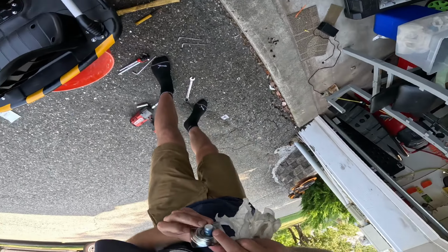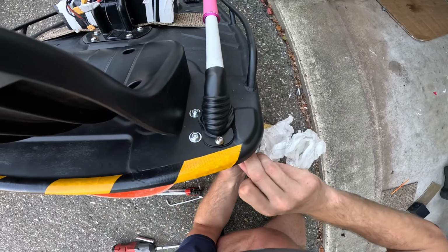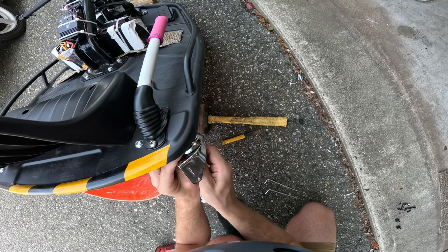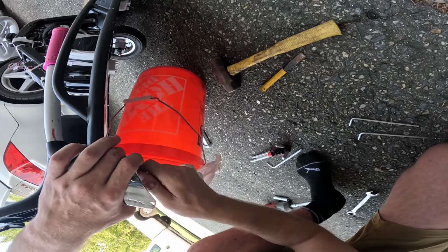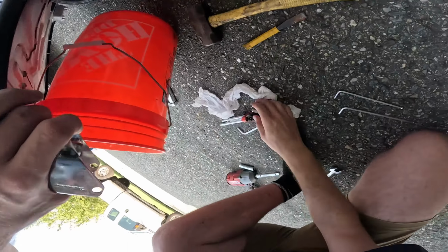ring in it. So once the kingpin is tight into the drift bar, it'll lock your caster together and nothing will come apart. But while you're screwing it in, it's important to hold all the pieces together. That way your ball bearings don't come flying out and go everywhere. So you'll see I grab it with my two fingers from the top, or from, I guess, the left and right side you call it.